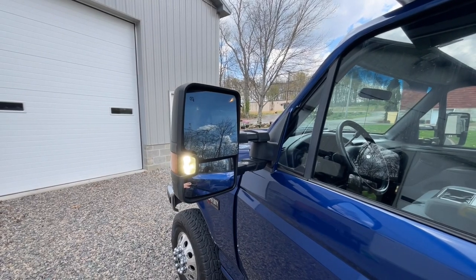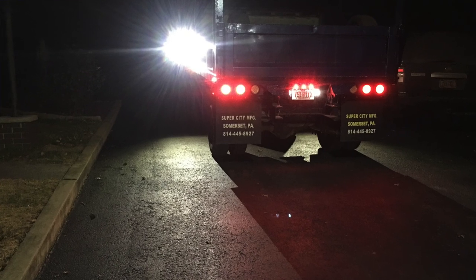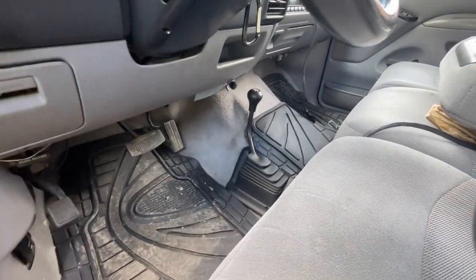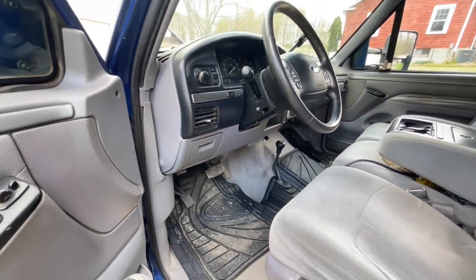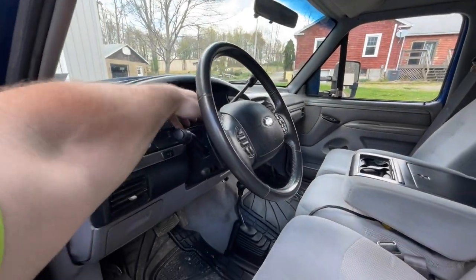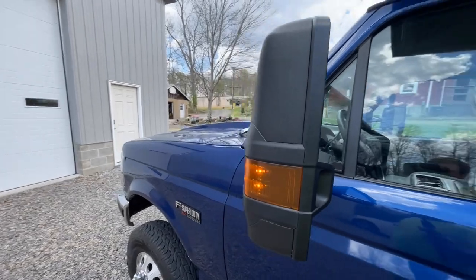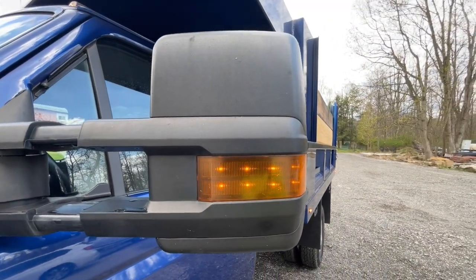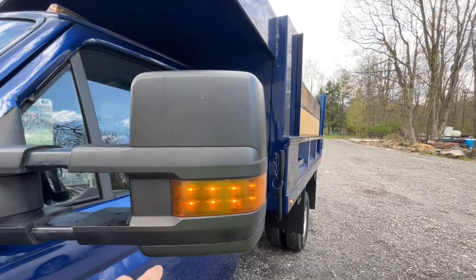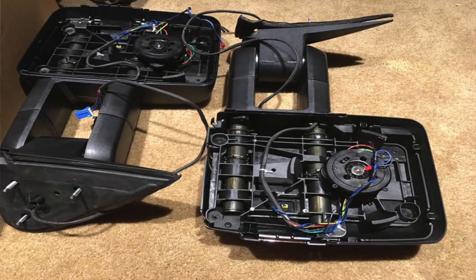The switch I turned on is for the backup lights in the mirrors. I have a picture of those at night — they shine pretty far, something I'm really proud of. There are buck converters and everything else to run those. The marker lights also work in the mirrors along with a rear turn signal. When you buy these mirrors you wire them to either turn signals or marker lights but not both — so I took the mirrors completely apart to do both.